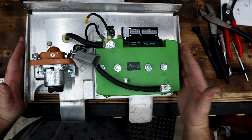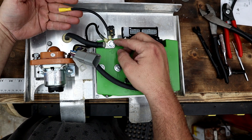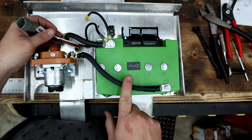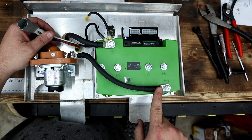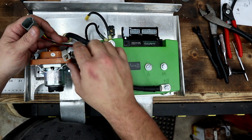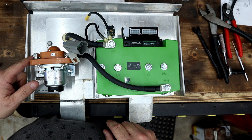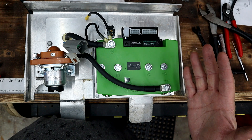Now everything is on this OVC plate and it's ready to go back in the cart. We have all of our small cables wired back in with eyelets, everything's heat-shrunk, main negative cable is on, and we have our cable going from our solenoid over to the B positive on our controller. All we've got to do now is put this back in the cart, plug up the rest of our OVC, run our three motor cables U, V, and W, then run the positive and splice in a couple wires from the factory harness.